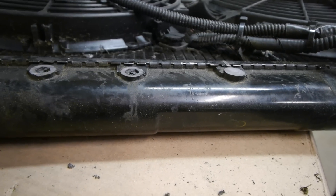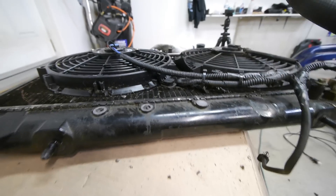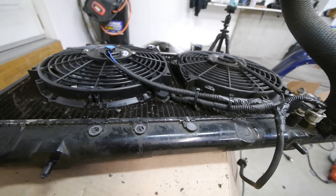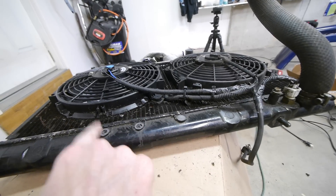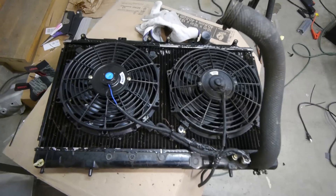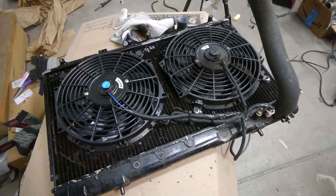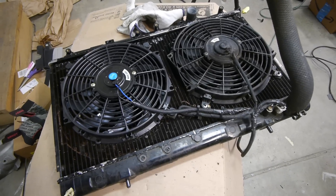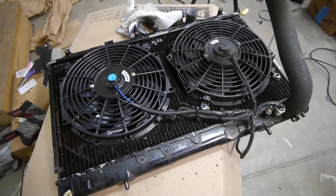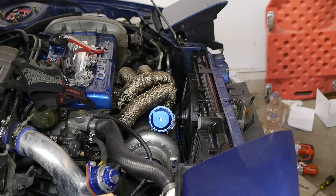I got both fans mounted and chopped off the lower mounting locations for the stock fan setup. Got another half inch of clearance where we were running into issues with the intercooler piping, so that should help — assuming I didn't heat the radiator enough to cause a leak while grinding. This is ready to go back in with the two slim fans. Check out the wiring on this three-year-old fan — no reason I pointed that out. Once I got the radiator in and the fans hooked up, I switched them on to make sure they were working.